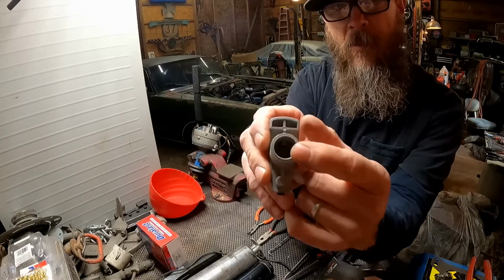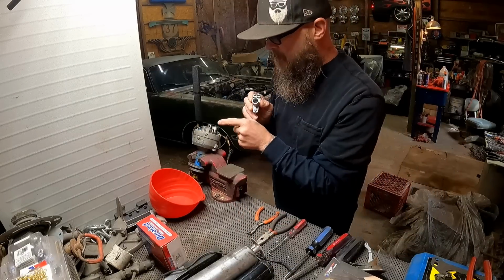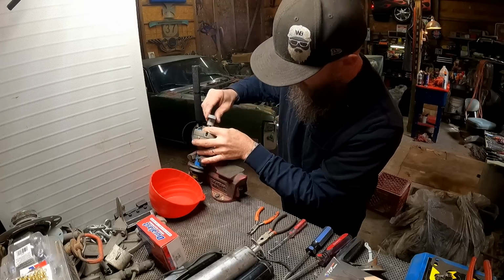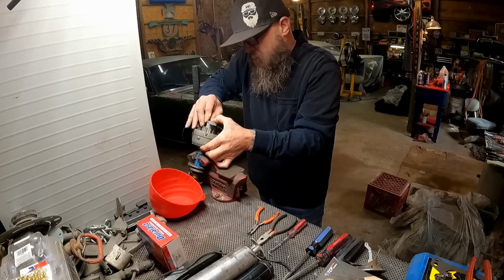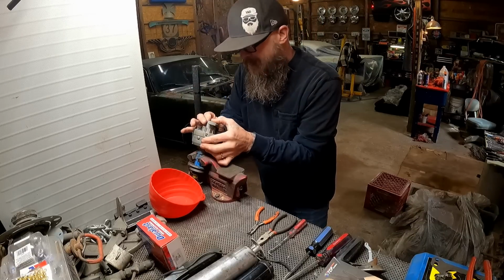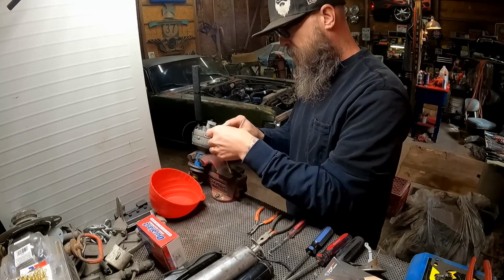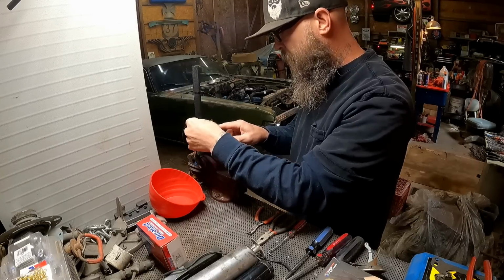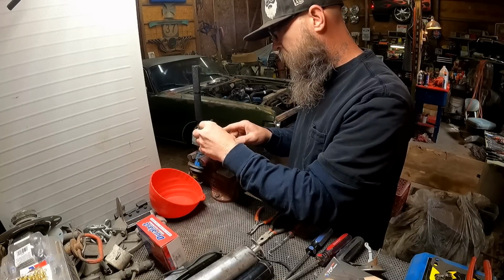We'll follow that up with the rotor. It's got a little thing inside of there that is going to slide right into this little notch. So be sure to line those 2 up. Push it all the way down on there. Don't push on that, but push all the way down on there. This wiring harness needs to come over here to its groove.